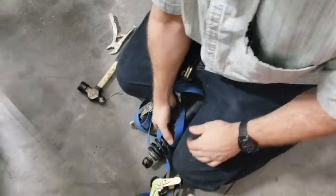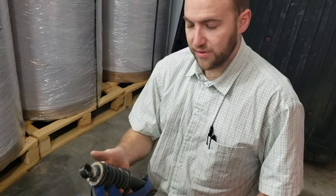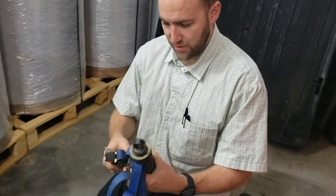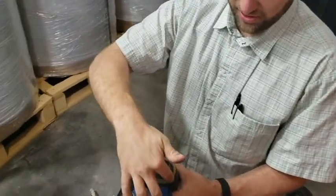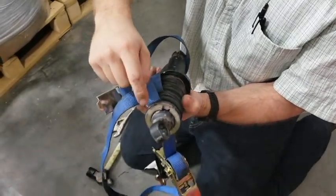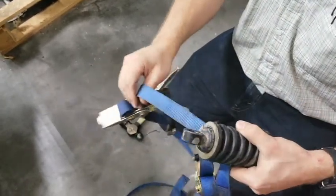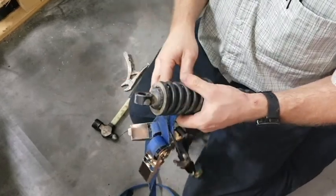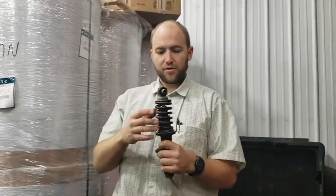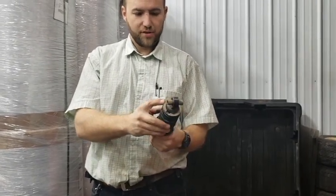Now this setup works really well for lighter duty springs like ATVs and golf carts like I'm doing. Look at that — this opening should actually be on this side. I'll see if I can move it with my vise grip, because the spring end collar space should be opposite of this. I wasn't paying enough attention, but I'll move it. I got the shim on and the space where it needs to be — directly opposite the end of this spring. I got the bushing back in.